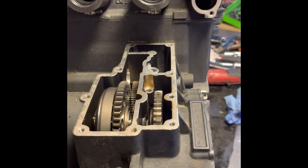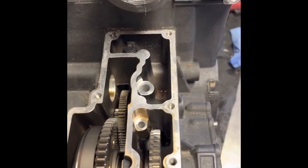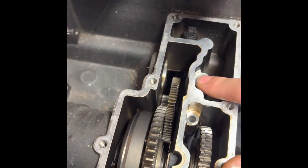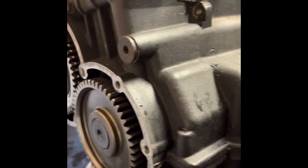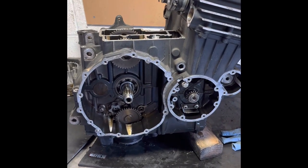I'm tearing this engine right down to do some bits and bobs to it. If you have got the upper access panel and want to remove the bottom casing anyway, there are a few bolts in here you'll need to remove — the two bolts here, a larger Torx head bolt, a few down the side, and two at the back. With those removed along with the side casing cover for the balance shaft gear, everything else can be done from underneath.